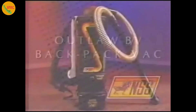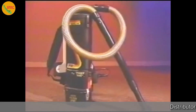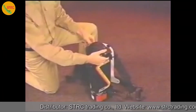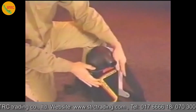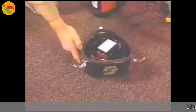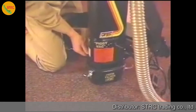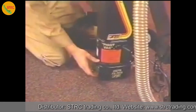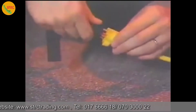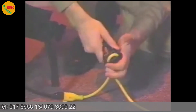Now let's take a look at each individual machine, starting with the Outlaw BV backpack, a single motor unit designed to be worn like a backpack. To get the Outlaw BV ready for operation, first attach the top cover onto the unit. The intake may be set up for either left-handed or right-handed use. Then attach the vacuum hose by rocking it onto the intake until it's secure. Your Outlaw BV may also be equipped with the optional HEPA high efficiency particulate air filter assembly, which attaches by simply snapping it onto the bottom of the unit. Attach the removable power cord, then thread the cord through the cord strain relief and attach the strain relief to the machine. This helps prevent the cord from pulling out of the electrical socket while you work.